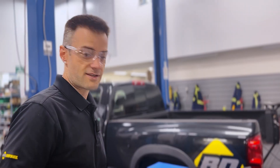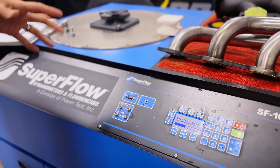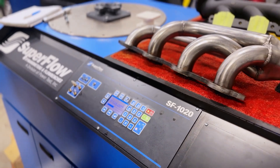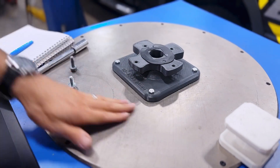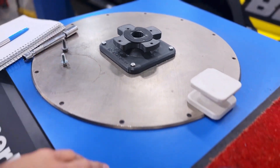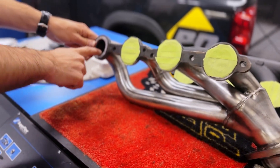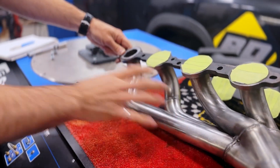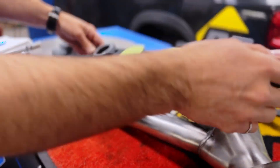What I got here is our Superflow 1020 flow bench. We've been using it for all our exhaust manifold development and all the flow numbers you guys see on our website — it's all coming from here. Got a flow bench adapter here, and we're going to strap these manifolds on. For example, we're going to flow this longest runner here, which should give you an idea of how these manifolds are flowing.